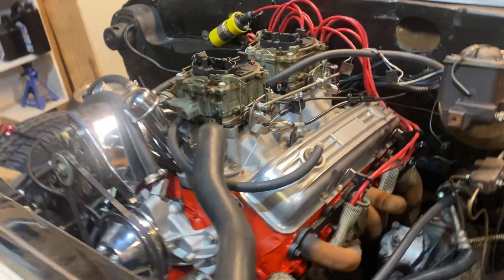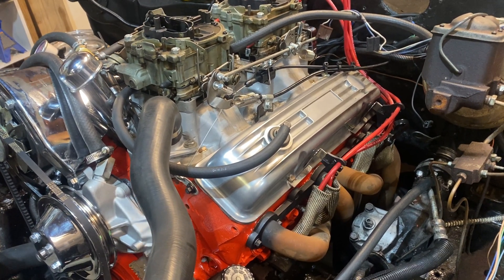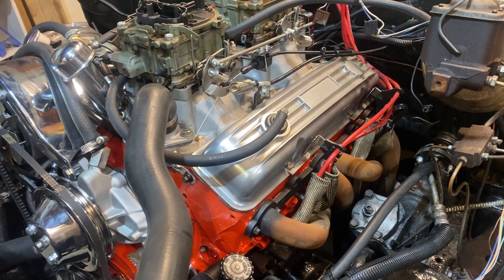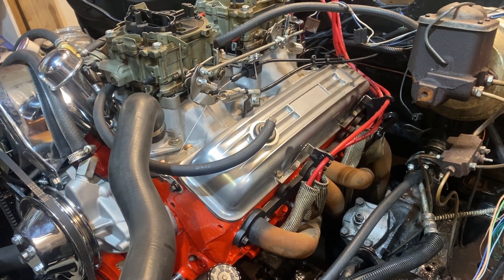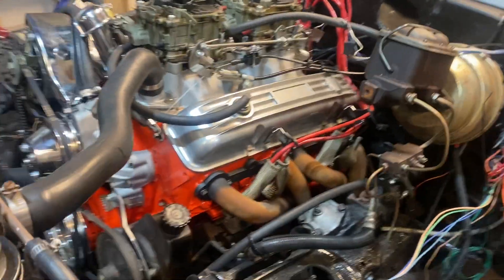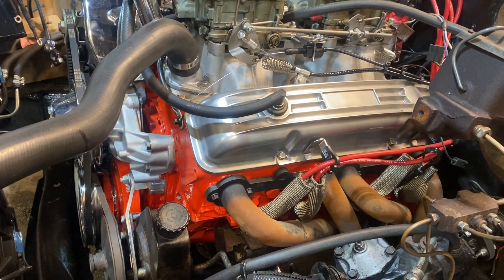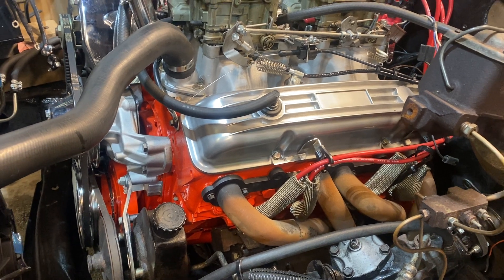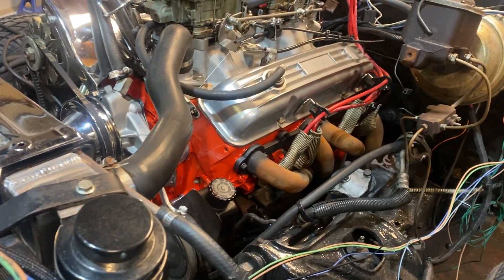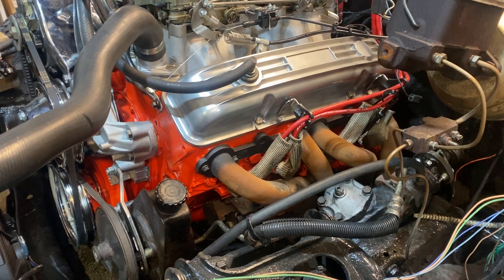I learned this from a couple of people. The whole idea is you want to keep your oil pump going for as long as possible. If your oil pump fails and won't pump properly, you're not getting oil throughout every part of the motor. Oil pump failure is bad — very, very freaking bad. So to prevent that, we've changed the oil and the filter. After 50 miles I'm going to change the oil again, and then it should be good to drive on regular zinc additive oil, like the Lucas hot rod oil — specifically 10W-30 Lucas High Zinc oil. And this thing would run great on it.